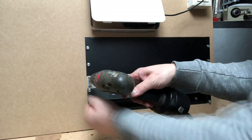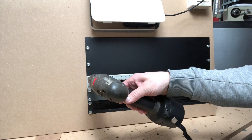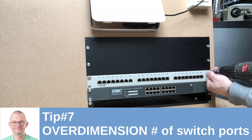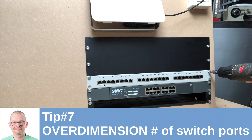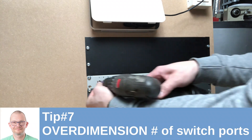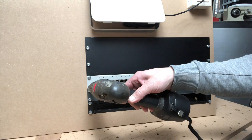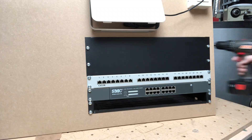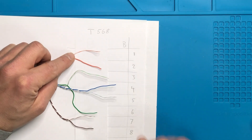When I built my own home network I thought a 16-port switch was largely enough because I only had about 8 or 10 devices. Trust me — over time you will add more devices. You don't necessarily run more cables but maybe you add a Raspberry Pi, a server, or maybe you want to run a phone line. Do over-dimension the switch — if you are running 12 cables, use a 24-port switch.